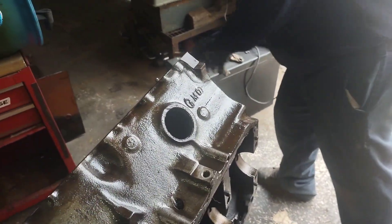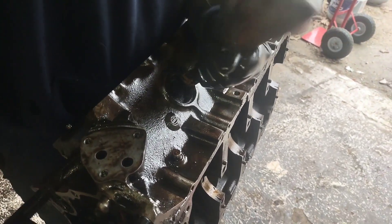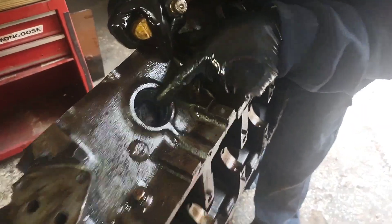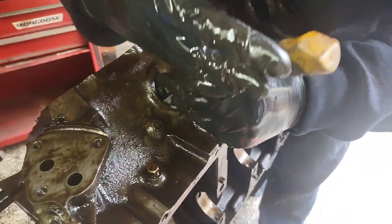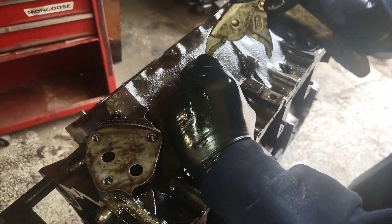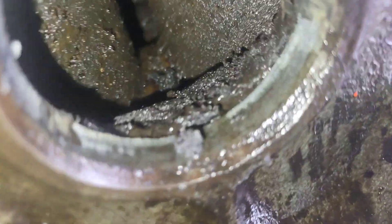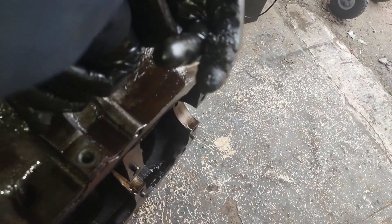There is your happy magical freeze plug. Let's take number two off and see what we see inside. You can see the grime and grunge in there — that would be why my coolant system was getting very, very dirty even though I have a brand new overflow tank and a very expensive radiator. The block is filthy. I did flush it out but obviously it wasn't quite enough. Look at that layer of grime in there — that's in your cooling system!